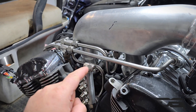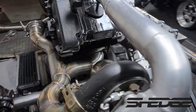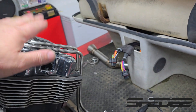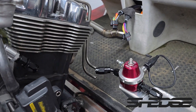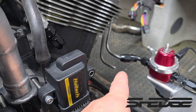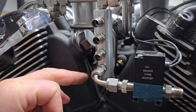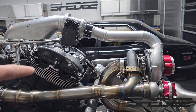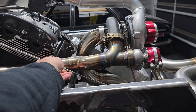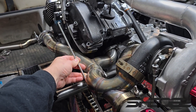Here's our manifold all done now — as you can see we've got a bit of complex tubing going on. Everything's working, adapters are in and all the lines are done. Jumping around to this side you can see where they come out. I've miscalculated this measurement slightly — it should have been a little bit lower — but for how long it took to make these I'm probably not going to redo it. We've got a PCV valve there with quite a big diameter so I didn't want it hitting this tube once the AN fitting goes on. So we'll leave that and start making the quarter-inch lines. Here's our first little bend — a short 90 — then we come down, follow the fin angle, and meet up to that one down there.